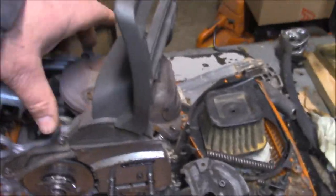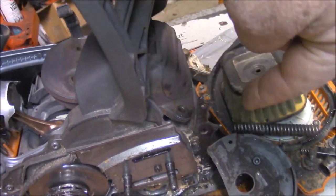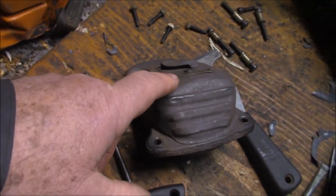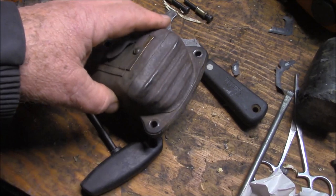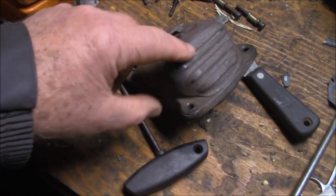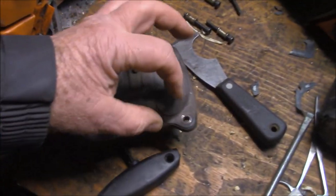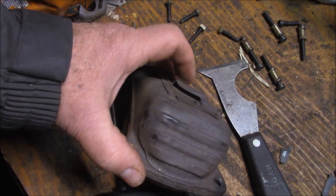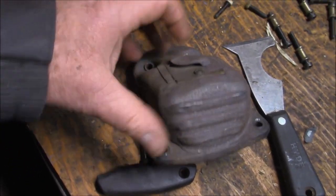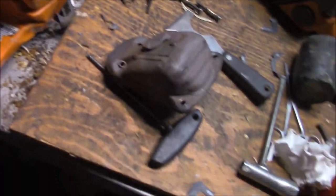For muffler clearance, I pretty much have to go in straight out, which is not my favorite angle of approach. It's got that double-thickness piece of steel there, so that's going to be interesting. I may have to cut that back in order to get enough of a hole. I want to put a pipe on that - probably a three-quarter inch diameter pipe. I could probably just open up this a lot; that would open up that pressure can quite a bit and reduce the resistance. But that's not what I like to do.